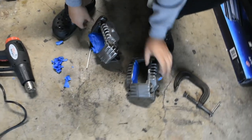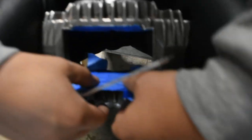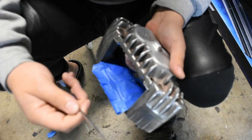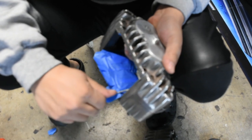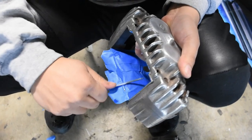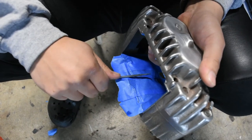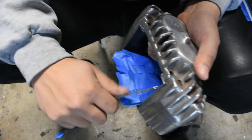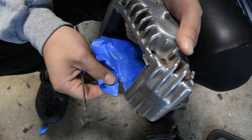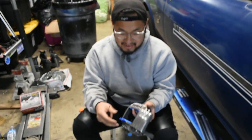And I'll show you guys a little tip of the day. So when you're taping edges on metal and you don't have a razor blade, you can just get a straight edge and slide it down, kind of scrape it, and then it peels off pretty smooth. I'll just do that to the rest of the calipers and then show you guys the end results.